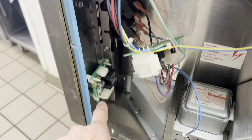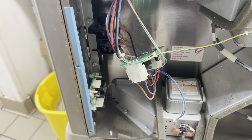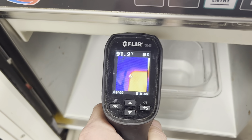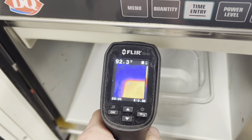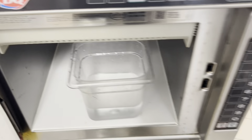Let me get this one screw here - that board pulls out, new one goes in. Then we'll run it through a heat test and see if she holds up. 65-degree water in, 95-degree water out. They want 24 degrees in 40 seconds - we got it.